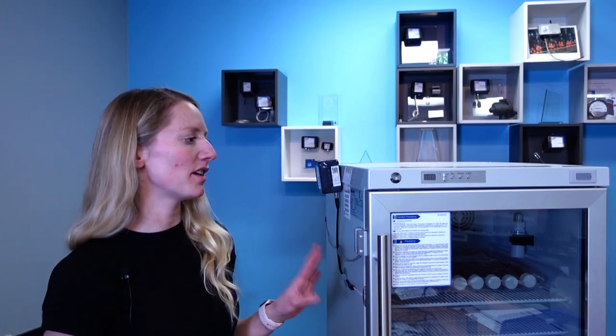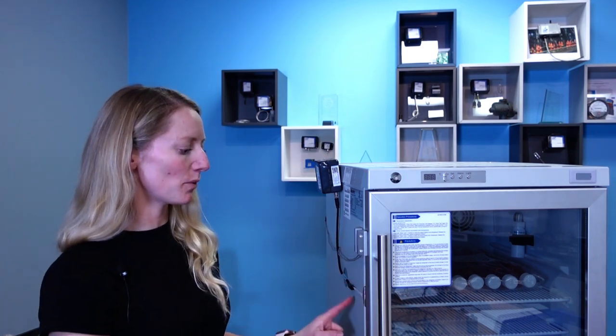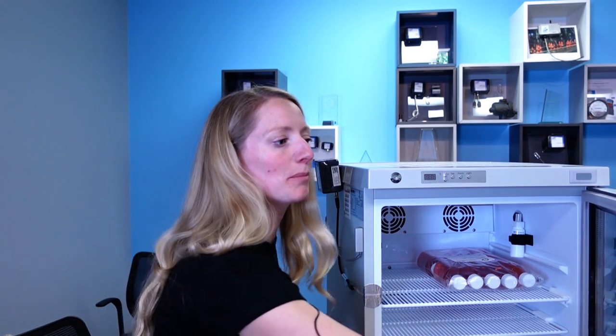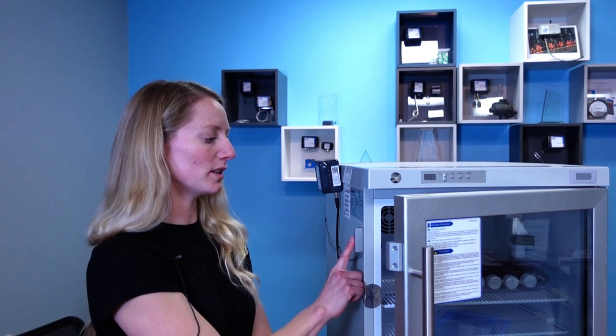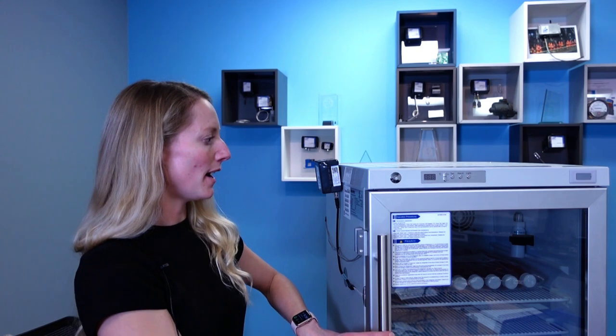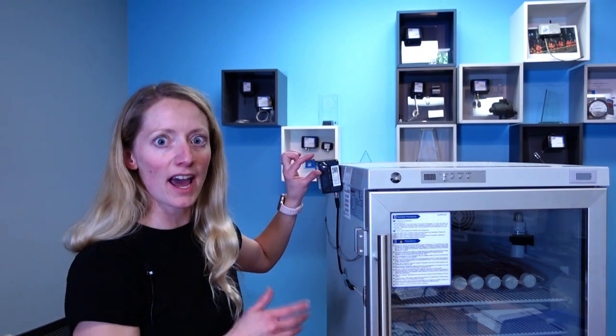As you can see, I have the Leap refrigerator freezer monitoring system already installed. I have my Leap transceiver node up here with the cable running to the flat ribbon cable, inside the fridge, going to our thermal bottle and buffer, and then our filled replaceable tip. We also have our door sensor installed — one side on the door, one side on the fridge itself — so that it gets triggered any time that door is opened. To make sure you get great reception with your node, try to install it at the top of your fridge. If you can, try and leave about a half-inch gap for that signal to have the best strength.